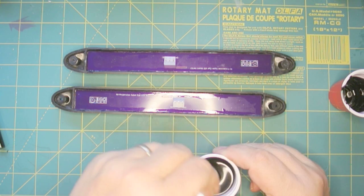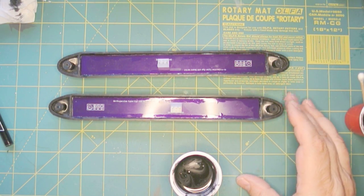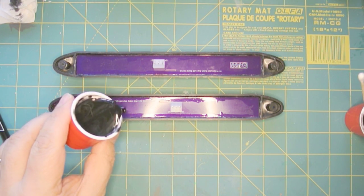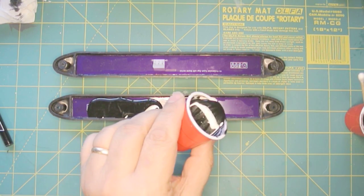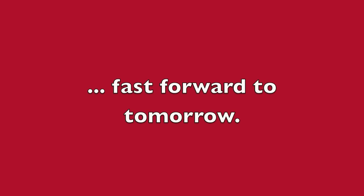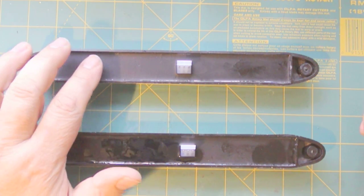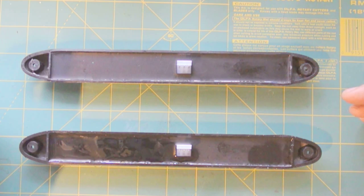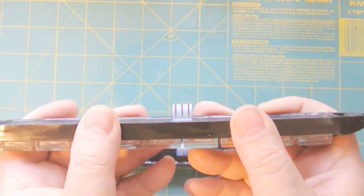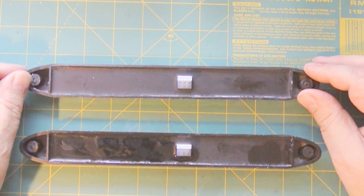You can take your time and stir this — the more you get it mixed up, the better it's going to work. When we pour this, we want it to be on a flat surface as flat as we can get it, and someplace where we aren't going to disturb it for a while. Just kind of run a bead through here, try not to get any on the connector itself, and let it find its own level a little bit. We're now about 24 hours after the initial pour, and it's still just slightly tacky. This stuff takes a lot longer than the standard-style potting compound — two or three days is what it's going to take. You can still bend it slightly, and that's why I used the flexible potting compound, because again, there is a slight bend in the front of the RV.